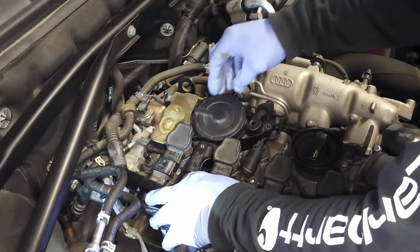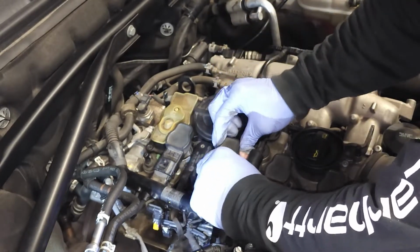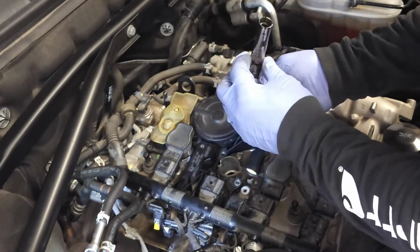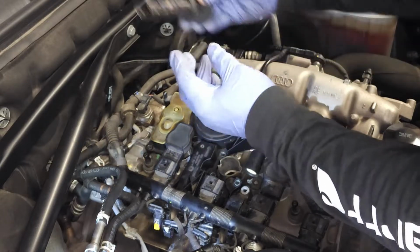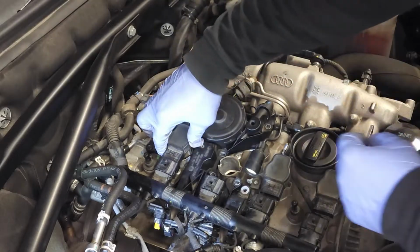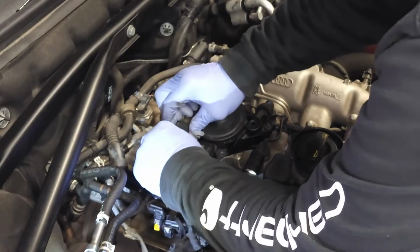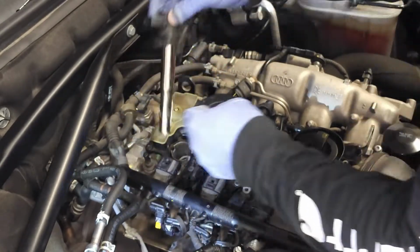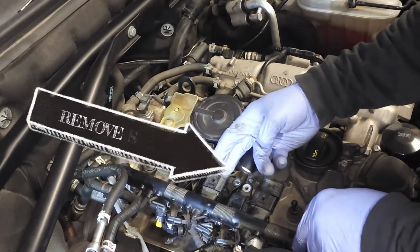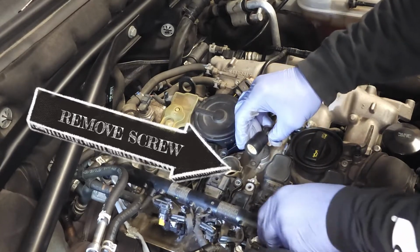It looks pretty loose. Now you try to lift it up and you wonder, what's going on? It won't lift. So you have to remove these coil packs. This one right here. Always inspect the coil pack when you take it out. This one is in excellent shape. Watch how I pull it out, and I'm going to set it off to the side so I can put it back in the exact same location. I've already loosened them up a little for the demonstration. There you go. Now, I've pulled back this harness a little by removing this screw. Sorry, I didn't show you that earlier.